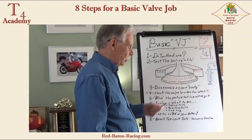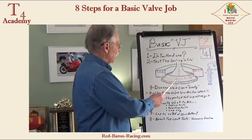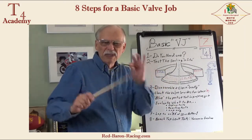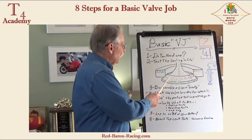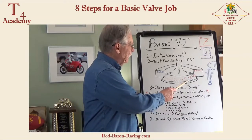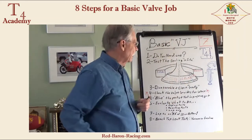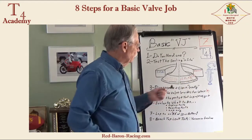Here I have a representation of an intake valve side. Intake valves run cooler and often have only light speckling from minor pitting, corrosion, or deposit buildup. Exhaust valves, on the other hand, can have very deep pitting or even trenching, where the valve was open and exhaust plasma blew right through. The seat can also be eroded.